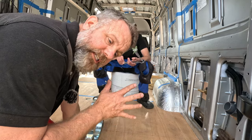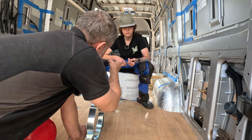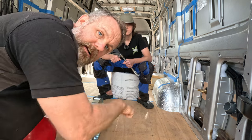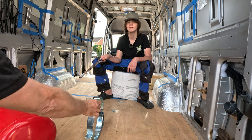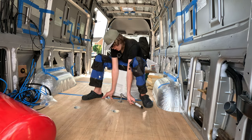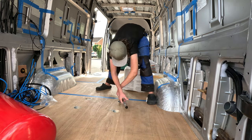It's going to be a bit faffy because normally you'd put the two brackets in and feed the tank into one, go beyond where it needs to be, then come back into the other - but because the brackets are close together so we didn't hit the joists in the floor, that's not going to be possible. I'm going to fit the first bracket, then I think we'll need the van jack to jack the tank into place with the second one. We want 40 to 45 newton metres so we get to use our new torque ratchet - John's going to do that on top while I go underneath.